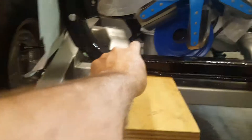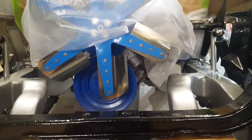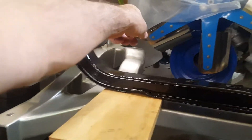The battery hooks on the other side of this 302 — the starter is right there, so the battery is already there. I just have to put the battery on and hook it up. The ground is already set, which goes right directly to the bell housing, and from the bell housing it goes right to the chassis on the back strap. I just have to put one more ground strap from the firewall to the chassis to the fender on this side because it's closer. But there you go — that's what I'm up against. Have a good day, Jim's Hot Rods of Beyond.